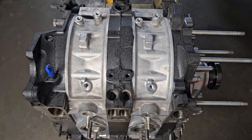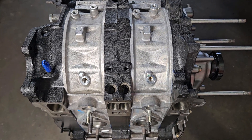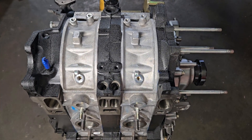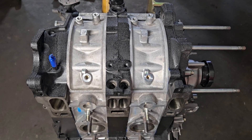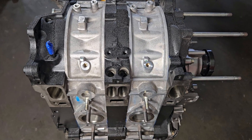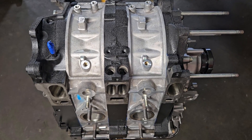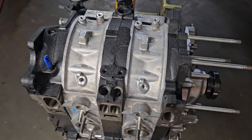We went with ENJ seals, and in this case it's a rarity these days, but these rotors had already been modified for three millimeter apex seals. In order to save the rotors for the customer, we stayed with the three millimeter apex seals and went with an aftermarket version made by ENJ. The rotors were 1993 to '95 rotors that had been modified in the past for a three millimeter seal — probably a racing rotor from the past — and we were able to special order some three millimeter apex seals to match.